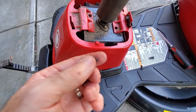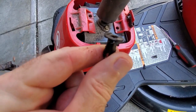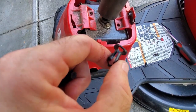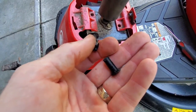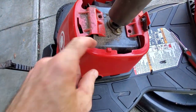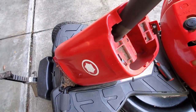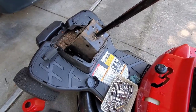Once you remove the center piece, that leaves behind the outer piece and you just pull that out. If you try to pull the whole thing out at once, you'll never get it out — the way it's designed, it flares those two side pieces once the center peg is in and it won't come out. So pull the center out first, then that gives you the ability to lift up and out of the way the bottom part of the cowling.